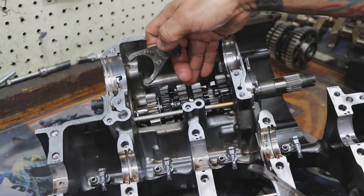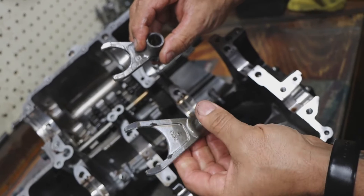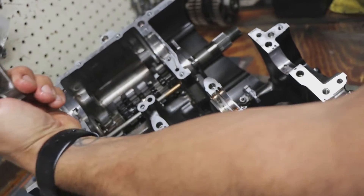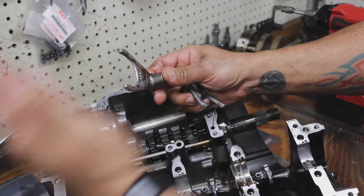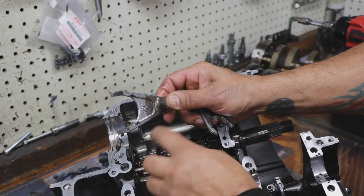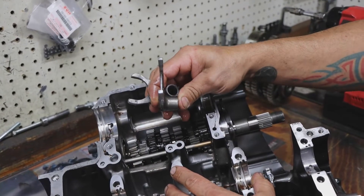These generally don't see as much damage, but there is a little bit of wear — you can see a little tiny spots right here. To restate it: once you lose your undercut on your transmission, the gears are trying to get forced out of gear by the engine — they're getting kicked out. But the forks are staying where they are because they're locked into place on the shift drum. Their job is just to move it and hold it there. All the damage here is because that gear keeps trying to push itself out — it's burning up the light oil film on here, which is why there are burn marks. These still look really good compared to some I've seen, where they're half this thickness and it was jumping out of gear for a long time.